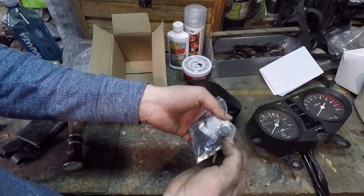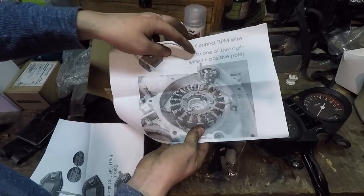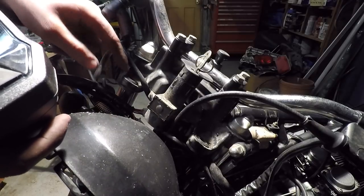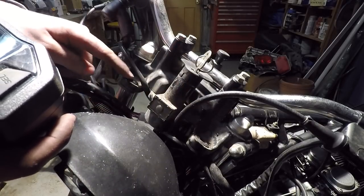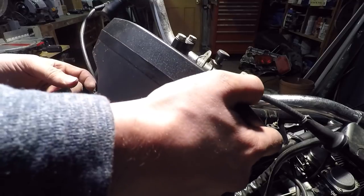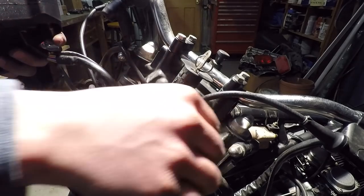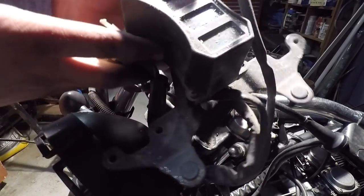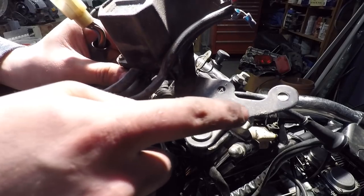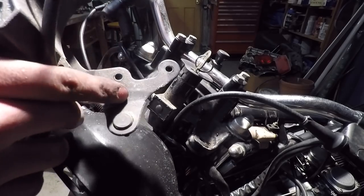There's the new speedometer sensor that goes on the wheel and measures how fast the wheel is spinning. I can already see I'm going to have to make some brackets because the bolt positions for the old speedometer bracket don't line up. I've got this old CB750 speedometer bracket here, and if I just cut right there and there I think I'll be able to bolt that on and then bolt on the new speedometer.